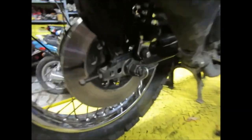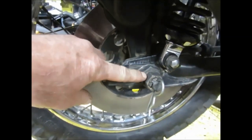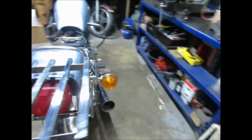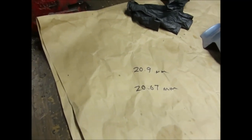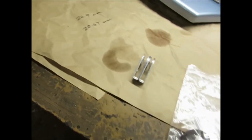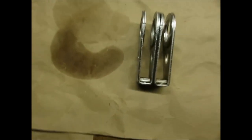On this one, the hole diameter that goes over the axle is different, meaning it'll pull back just a little farther than the other. Even between identical models they're different — I measured them and found a difference of 20.9 millimeters versus 20.67 millimeters on another KZ 750 twin. That's a difference of 0.23 millimeters, which doesn't sound like a lot, but it adds up.